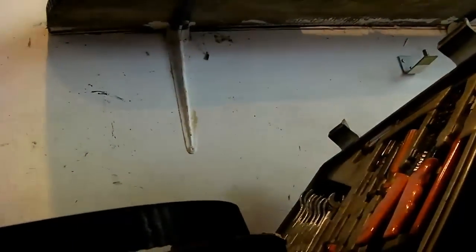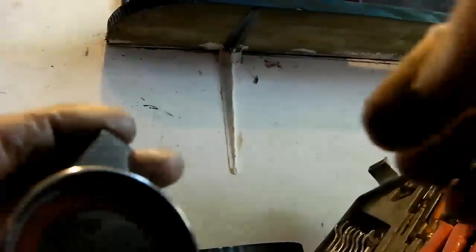It doesn't look bad, however, if I can balance this somewhere on my knee, for example, there, and whoop, now I don't know if you can hear that. It's not bad. It's not horrendous, and it would probably last for a good few thousand miles, but it's certainly drying up. You can hear that. Now I'll just give you a comparison against the new timing belt tensioner, which is here. Looks exactly the same. You can tell that that's nicely packed with grease. It's a sealed bearing inside there, and no noise, no play, nothing.